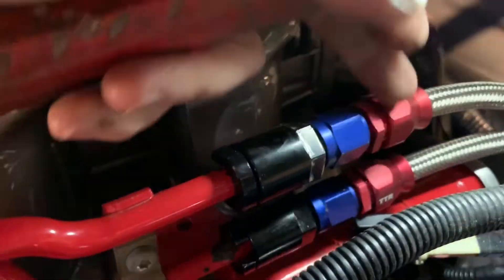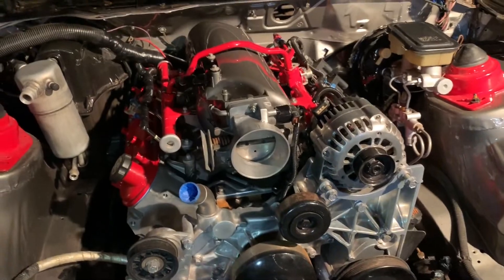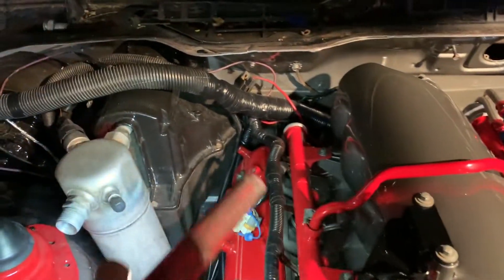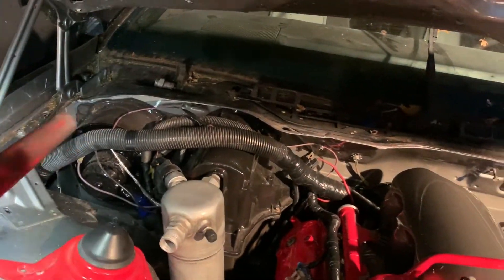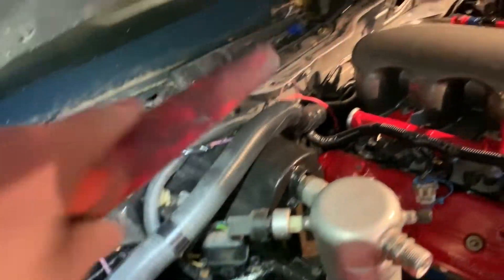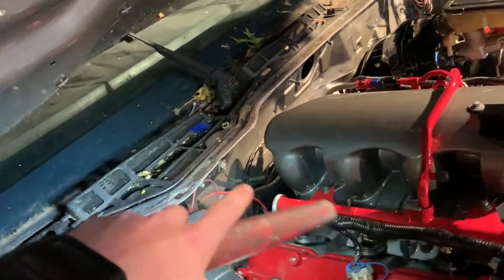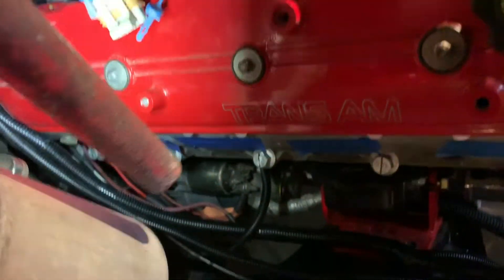Up here we've got the supply on top and the return on the bottom with those fittings I was talking about. The wiring harness is in and all the plugs are connected — it's just not hooked up to the fuse box yet. The computer originally sat here and I extended everything four feet so I could run it through the fender to the end of the dash. I cut everything to length so it's nice and tidy. The truck harness is all wrapped up; the third-gen stuff isn't wrapped yet because I haven't finalized the routing.